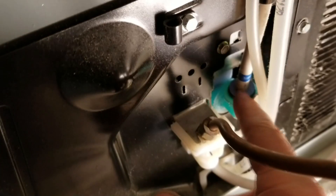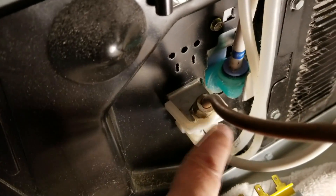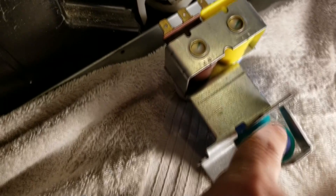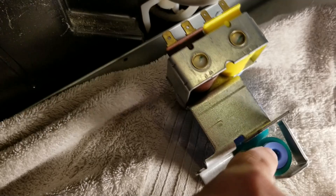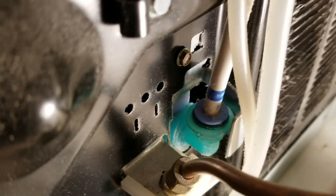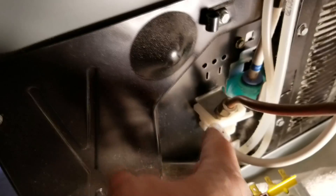Here's the bottom of the back of the refrigerator. The inlet valve apparatus is right here — that piece of metal right there. You can also see where the tube plugs into the top of the inlet, with that blue tube going right into the blue inlet. To get this out, we have to unscrew everything and also remove this back plate.